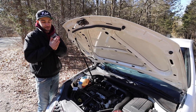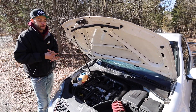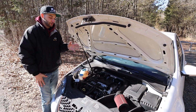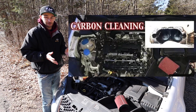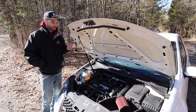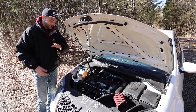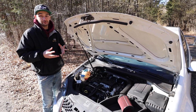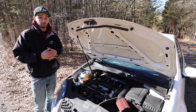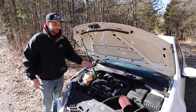Now we're getting into a more major thing - with direct injection on the FSI and the TSI, you have carbon buildup. You're supposed to do carbon cleaning every 40,000 miles on the intake manifold. I have a very in-depth tutorial on that which I'll link above - save yourself about $400 to $500 in labor. These intake valves get so built up with gunk and carbon that it causes misfires, stalling, poor airflow - it can really destroy the performance of your vehicle. Every MK5 GTI owner can relate to this.